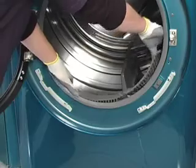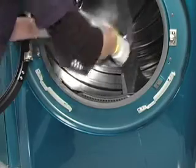Then extract one screw from each side of the air duct cover, securing the air duct cover to the inside of the drying compartment. Pull the air duct cover straight up until it is clear of the drying compartment.